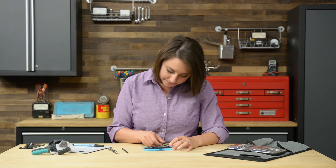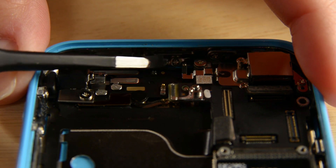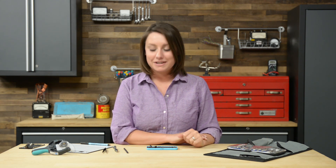A small piece of tape may obscure the logic board grounding clip, so use a pair of tweezers to remove the tape. There are a total of seven screws holding the logic board in place, and to remove those you'll need both your Phillips bit and a small flat head bit.